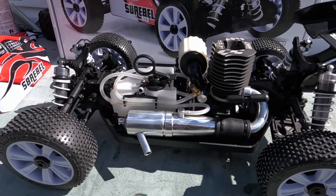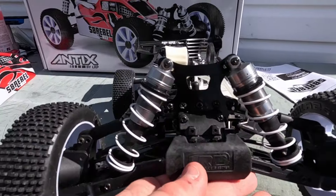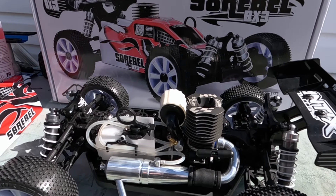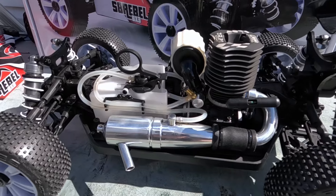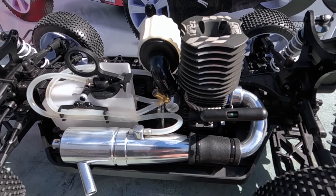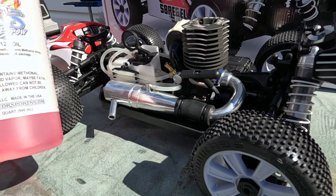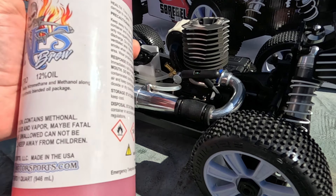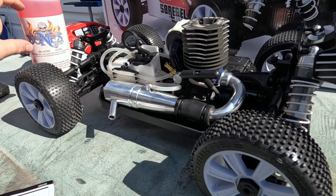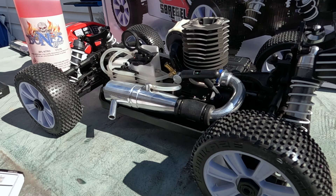What you're actually doing when plugging the exhaust is causing a little buildup of oil in the system, and unfortunately that makes it a little tougher to start. On regular RTR engines you really don't notice that, but on more performance engines that little element could be the difference between winning and losing a race. But this is after all a brand-new LRP buggy for about $400, so I'm not going to complain, although I would have liked to have seen a single-piece pipe design instead of the silicone coupler. For fuel, I will be using my last quart of this Bones Brew fuel, which was made with VP fuels. I'll put a link to VP fuels in the description. Going forward, Bones Brew is done — you can only get VP fuel now.